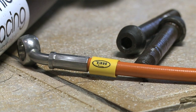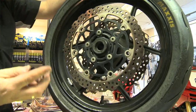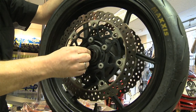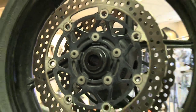And they're a luminous orange, which suits the bike nicely. Another small but very useful addition in the pit lane was the captive spacers. The captive spacers are a unique little gadget that will save a lot of time and frustration in the paddock when changing wheels. The captive spacers have a small rim which allows the spacer to be held in by the rubber seal on each of the wheel bearings. So when changing wheels, there's not as much of a problem holding the spacers in position to allow the spindle to go through.